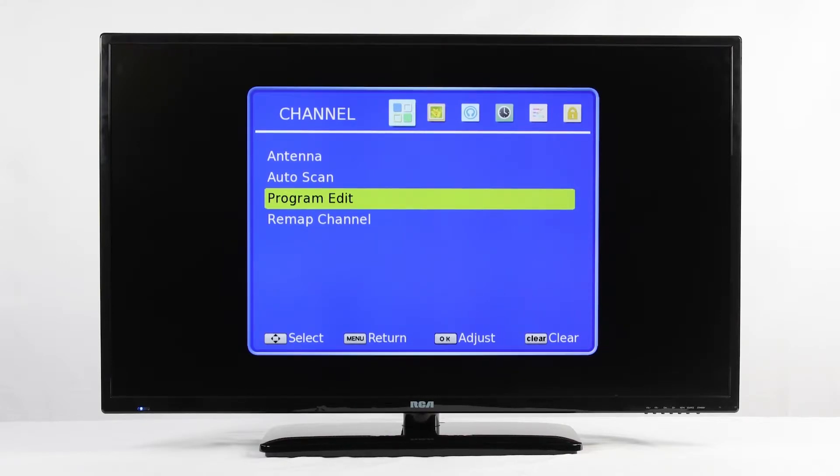If you have chosen Manual Index, arrow up once and press OK on Program Edit. This is where you will work to assign your channels their new channel numbers. This menu is sectioned off into three columns. The far left column is your new channel number — for ease of learning, we'll call it the index number. The next column to the right is your cable channel number as the provider delivers it. The far right column is your channel label, which may be blank but is where you can type the network name for each channel.